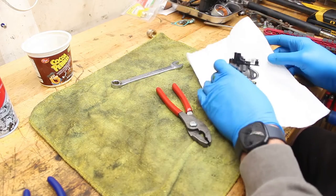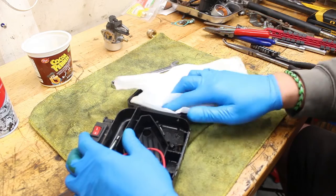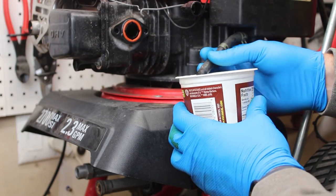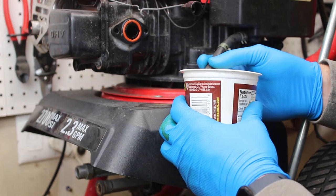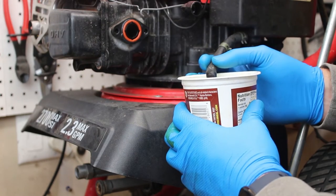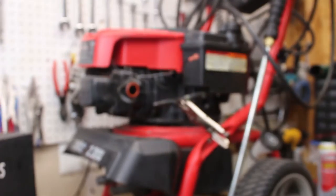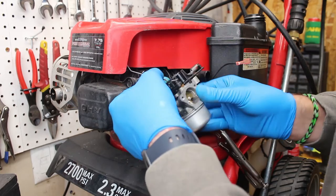Let me look at that fuel tank and debate if we want to purge the rest of the fuel. I'll clean everything out off camera - no need to watch, it's very boring. My plan with the fuel system: I've got this cup cleaned out and I'm going to drain maybe another eight ounces and make an assessment. It's a little dark - not the worst I've ever seen but it smells kind of middle. I'll purge it all out - it's only a couple bucks worth of gas. Let's get that carburetor back on.